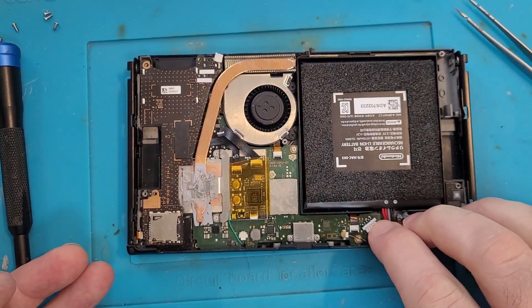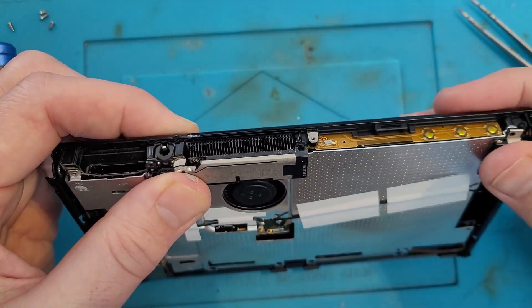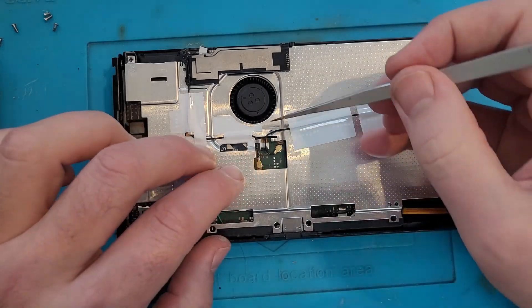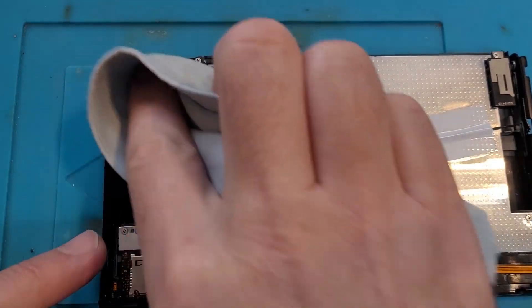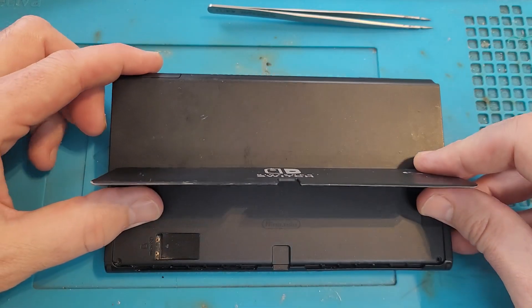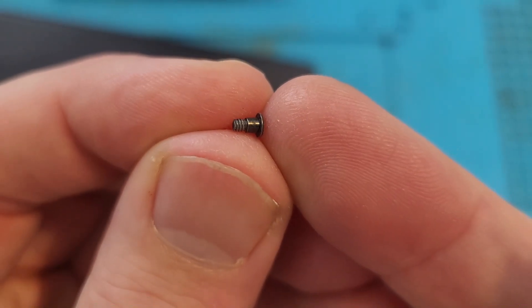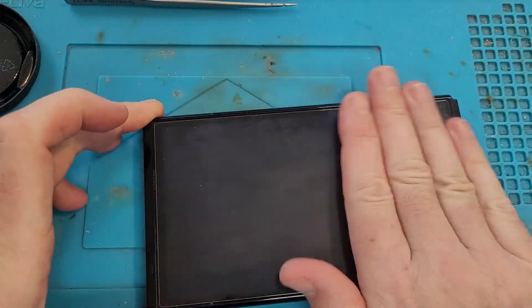Connect up the battery before reapplying the rear heat shield. Make sure you reconnect the two connectors. Give it a quick wipe to get rid of all the fingerprints, and then the back cover goes back on — I find hooking the bottom edge in first works best. It clips over the top; just be gentle on the sides and it should all click into place. Put all the screws back in — the one with the collar goes at the top on the side — and that's it.